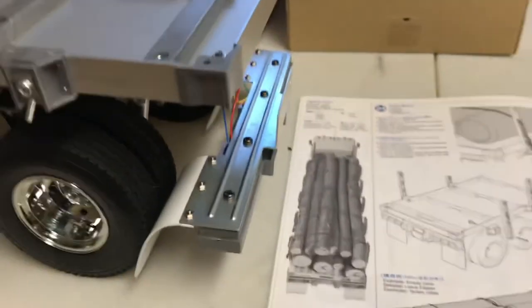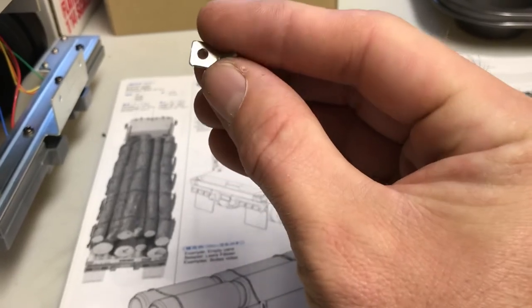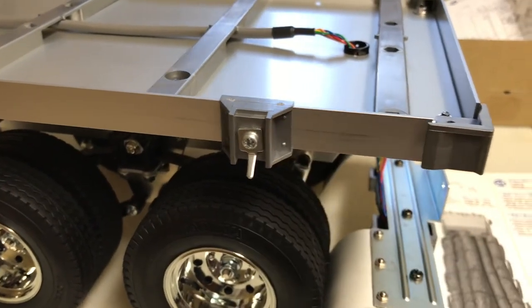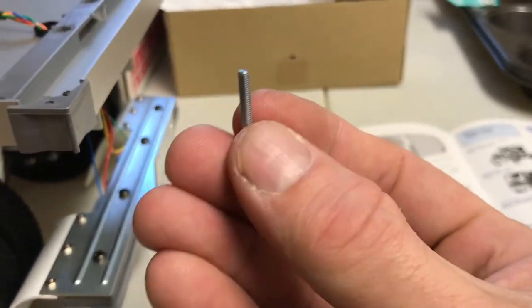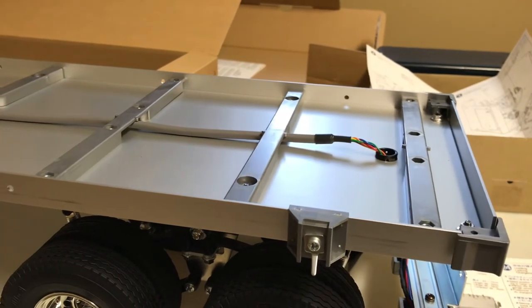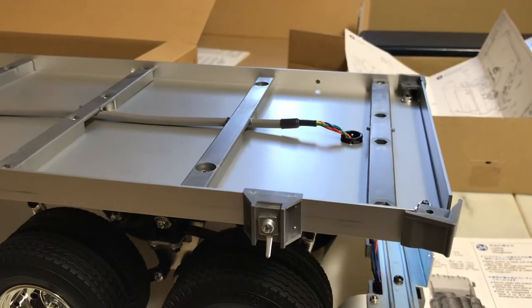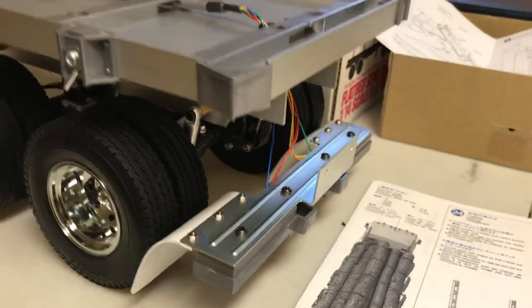The kit comes with these little hooks for the stakes where your chains hook on, but the holes in them are too small to attach to the flange nut inside the trailer. So I got a 1/8-inch drill bit, put each hook block in the vise individually, and drilled them out so the screws fit through. That way you can still have your chain hook points, or use them with mini straps to secure things to the trailer.